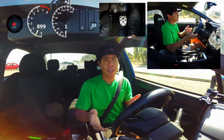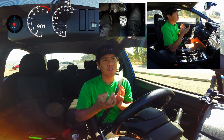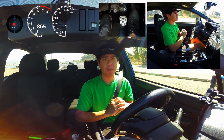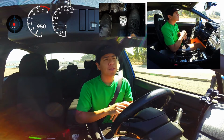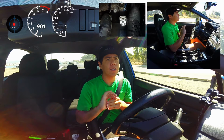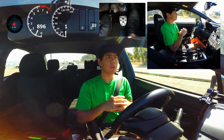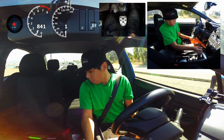And I don't know if I can show it to you per se, because it's very subconscious for me, but we'll drive around here, see if we can catch a few clips of my heel toe and maybe an over blip or an under blip. And the last part I would say is, as you're working on the heel toe, I think focus on getting the right engine RPM first. Then you can add in the subtlety of working the clutch. So let's get to driving.